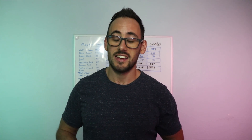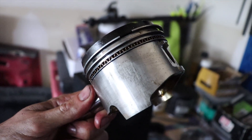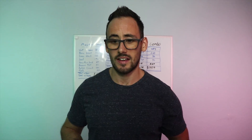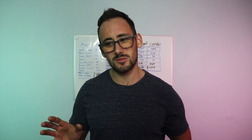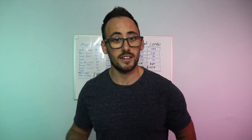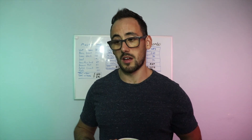Pistons - you just need them, you can't get around it. We have a couple of options: first, we reuse the stock pistons, which is not likely because they had pitting and obvious signs of detonation, some scratches - it was a little excessive. So the other option is we get a rebuild kit, which usually comes with stock cast pistons, brand new or remanufactured, and those are affordable.